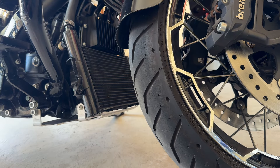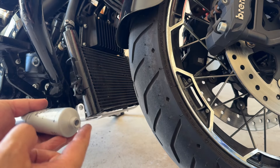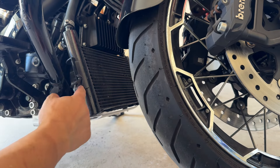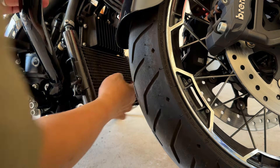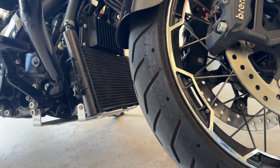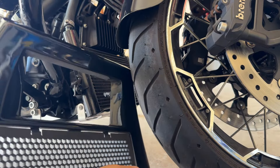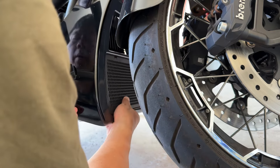It's now time to go ahead and remount the radiator cover. Before I do, I'm going to use this O-ring silicone grease and place a slight amount in each of the rubber grommets. That'll make mounting the cover a lot easier and also ensure the maintenance of the rubber grommets over time so they don't degrade. I'll get the cover in the right position, find the rubber grommets, and push it in. Get to the other side, do the same thing, and it's placed in nicely.